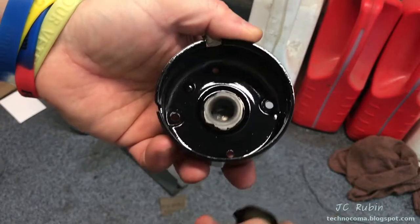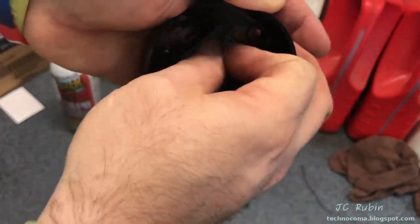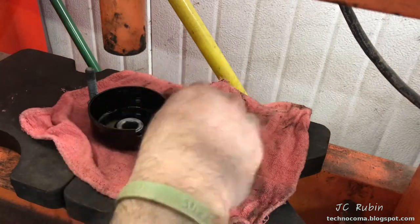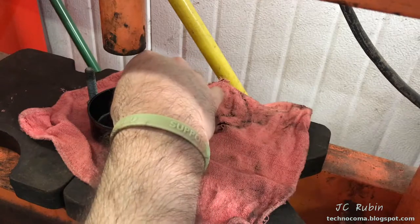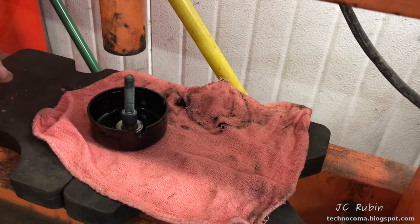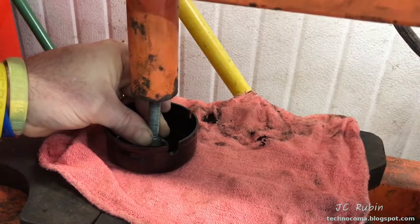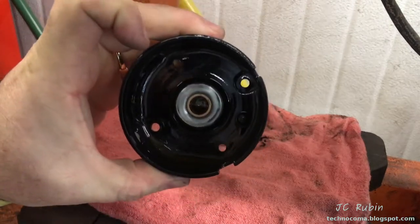Let it cool to room temperature and inspect — everything came out good. The polyester tape is removed, and the race gets cleaned up a little bit with some 1000-grit sandpaper to polish it nice. I set up blocks on the press with a hole and a rag, add a little lubrication to the cover and the new bushing, center the bushing, and use a Torx bolt — because of its flat round face — to drive the bushing in without marring the end surfaces. It went right in just under the chamfer. Looks really nice — this piece is done.